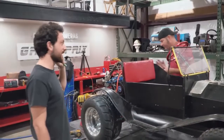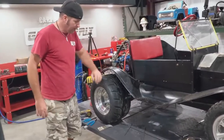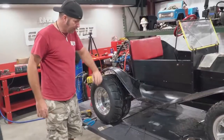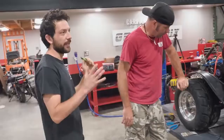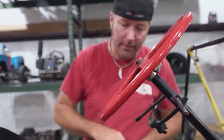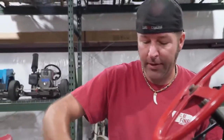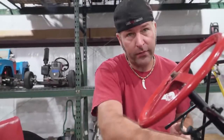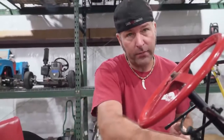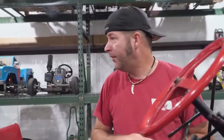It'll work — it's covering a little more than half the tire. I can't wait to try it. Pump the tires up really stout and just spray it in the center and it'll work. Yeah, it'll probably fling outwards once it starts spinning. I installed the electrical toggle switch. Now I'm installing a ground for the pump motor. Then, after that, we're installing a battery down here in the floor. All I've got to do from there is wire up a hot wire going to the switch and then a wire coming off the switch going to the electric pump. And then we can really test it.